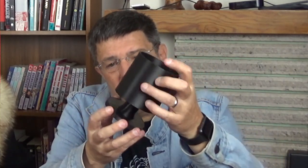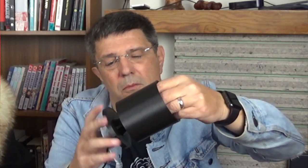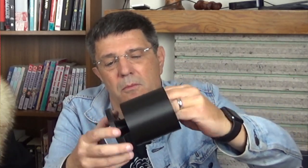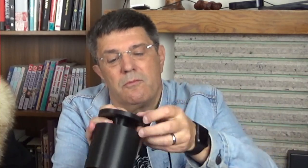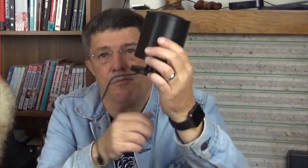Putting the fan in the Fart Eater is easy-peasy. First, screw the base into the tube until it's snug. Then just drop the cord down through the cone in the center and route the fan wire through the knockout in the side of the tube. You can then place the fan in the tray and secure it in place by screwing in the retaining ring. Once that's done, you can feed the fan wire through the channel in the bottom of the stand. Those little bumps help to keep the wire in place. To finish your assembly, just take the Fart Eater grill and drop it into the cap and then screw the filter into the cap. That secures the filter as well as the grill.